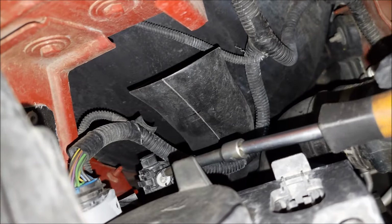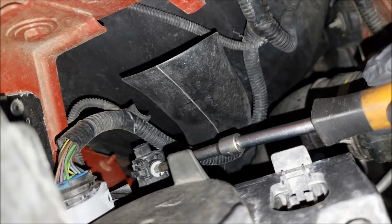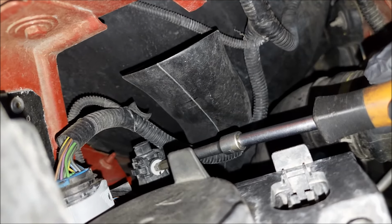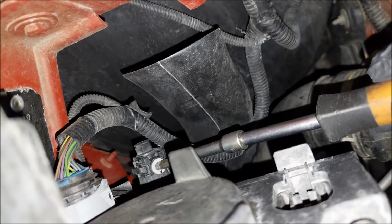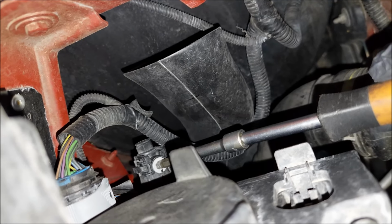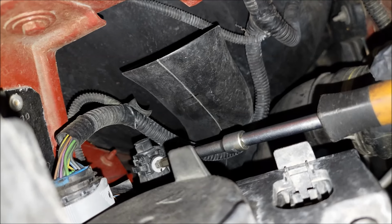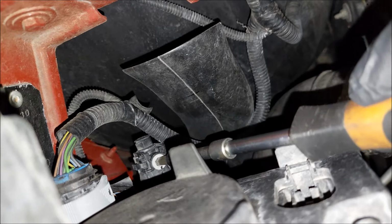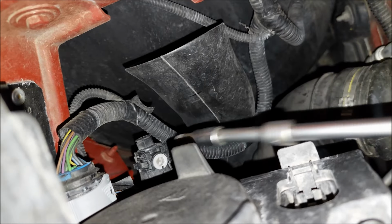Next, I'm gonna move on to this screw on the back. Now I'm basically gonna do just the same thing. I'm gonna turn it clockwise 10 times, and I'm gonna turn it back, and we're gonna see how the low beam light is gonna move. But since we already found the screw which moves it up and down, I'm guessing that this one is gonna move it left to right. Only thing left to see is if the clockwise motion moves it left or right.